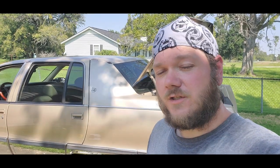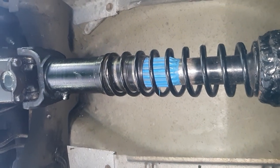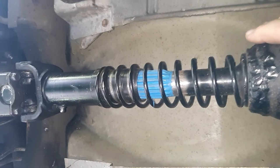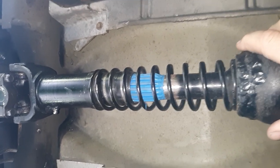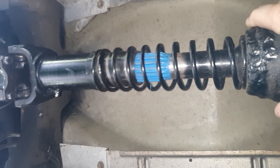The problem I immediately ran into — when I put it in the car it traveled fine, worked perfect, just as I needed it to. I drove the car down the road, it had some vibrations. I tweaked the upper trailing arms trying to get the pinion just right, seemed like it got better, then it kind of seemed like it didn't really make any difference. When I crawled back under there with the suspension compressed, I grabbed the driveshaft and you can wiggle it. This is a slip yoke with no pressure on it — there's about a half inch hanging out of the yoke on the tail shaft of the transmission, and this is what happens when you don't compress it. That will cause a hell of a vibration — sounds like some subwoofers beating down in your trunk.